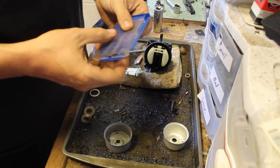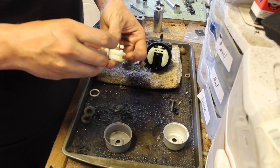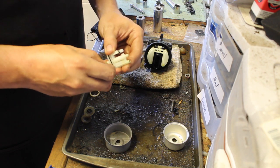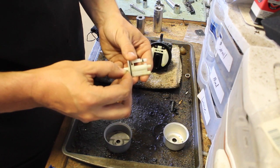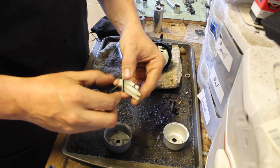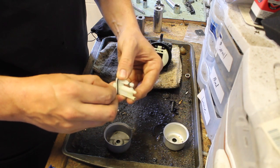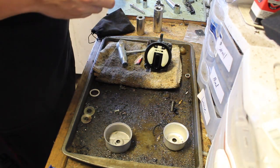Because it was so plugged, let's take a bit. It's going to go in there — we're not going to widen it, we're just going to clean it. Oh yeah, you can definitely tell that needed to be done. A wire will get it started for you, but these bits will finish it. I'll put a link in the description below for these bits, especially with this motor. The jets on this are so small that the smallest of clogs will cause a pretty significant problem. There we go — that's done.